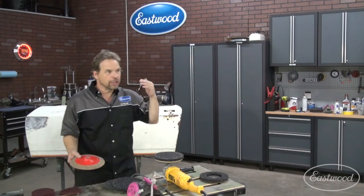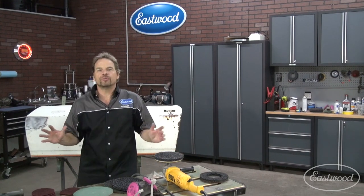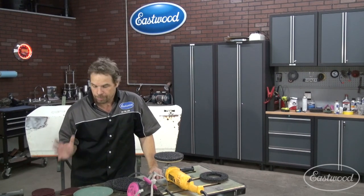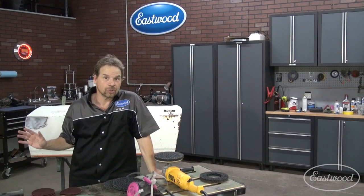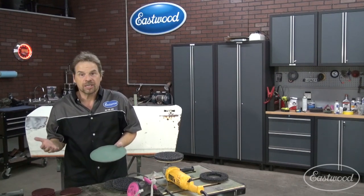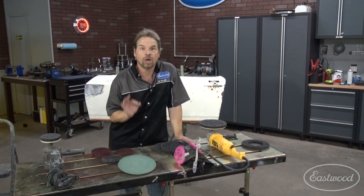So while the bed liner coating is drying on the bottom of Z Sled, we're going to take on another project - stripping the paint off the panels that haven't been stripped or blasted yet. Now in the 90s, all three of the big three automakers had a huge problem with delamination - paint coming off in sheets. When I was in collision repair, the fastest method we found was to take 36-grit paper on a rotary sander and strip it down to bare metal, build it back up with epoxy, then the top coats, and kick it out the door. It was very effective but a kind of a brutal way to get there. And if you ever hit rust, your paper is shot. That was probably the fastest way to get factory paint down to bare steel, but it probably wasn't the best way.